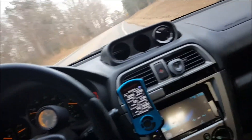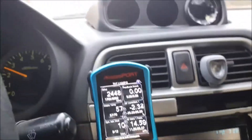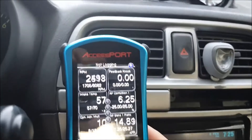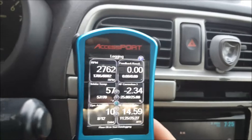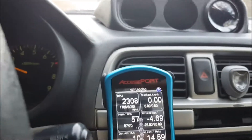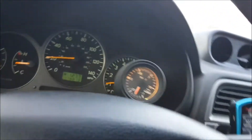I'm gonna let it warm up and we're gonna do a couple of runs down the road and data log it, then throw it in Virtual Dyno. The way you do a data log — if you have a Cobb Accessport 3 — you get into where your gauges are. When your gauges are up, hit the middle button. It says 'not logging.' Hit it again and it starts beeping — that means it's logging. Hit it again to stop. For Virtual Dyno you want to be in third gear so you're not going too high a speed.